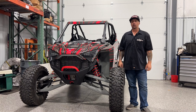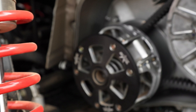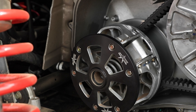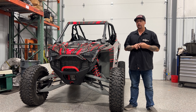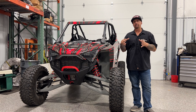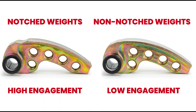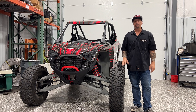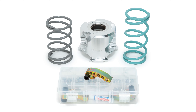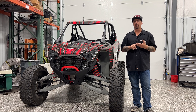Clutching was another area we wanted to cover as part of going back through and redoing everything. Polaris changed the clutch design in 2021, partly in response to early clutch failures on the 2020 cars. They beefed up the sheaves so that part wouldn't break anymore, which required a redesign on our weights. The new clutch packages include weights, helix, and primary spring. If you're running launch control, we can get up to about a 3,500 RPM launch with the spring and our high-engagement weight — really good for drag racing.